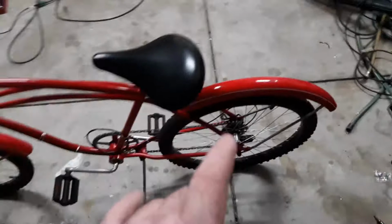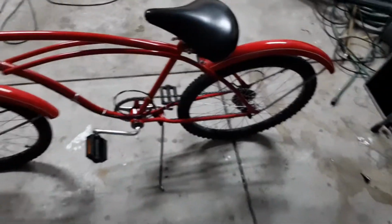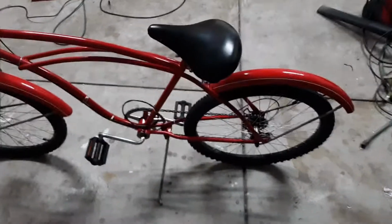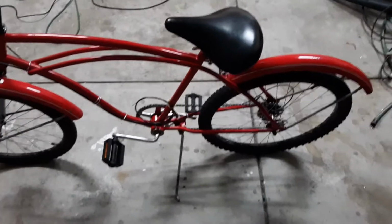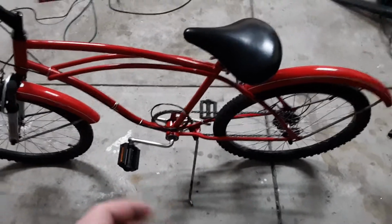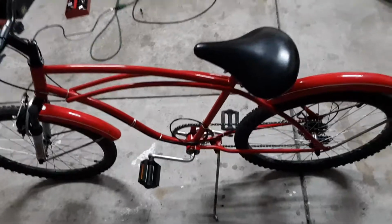I got some cables just around and stuff to make things function for now. I'm gonna go for the 56 tooth sprocket, and I put 24-inch tires on this. Our ground is a hard packed sand, which is just brutal to go through at times. It's not so bad, but there's always like an inch of sand at times. It's a weird consistency. So I figured smaller tires and a bigger sprocket. I don't care about speed. We'll go through it without stressing the motor too much, because that's basically everything here. So anyways, that's where I'm at with that.